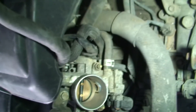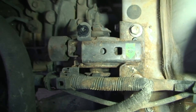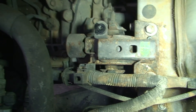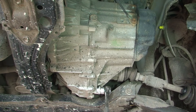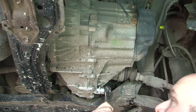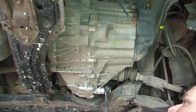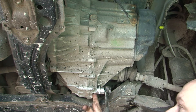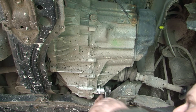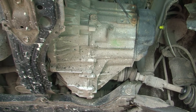We don't take off this engine mount yet until the gearbox comes out. I'm going to lift her up and start taking off stuff from underneath. We're underneath it now — all I've done is taken off the wheel and there was a plastic guard here which I've removed. What I like to do now is empty the oil, because we have to take the two drive shafts out, and if we don't empty the oil first it's just going to go everywhere.